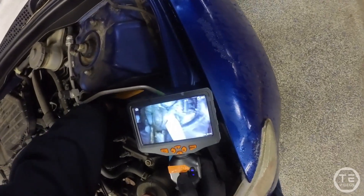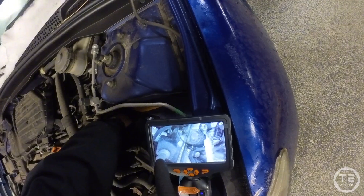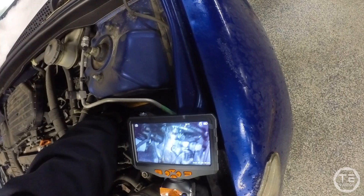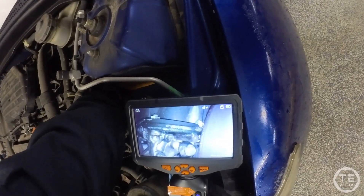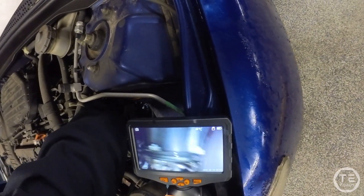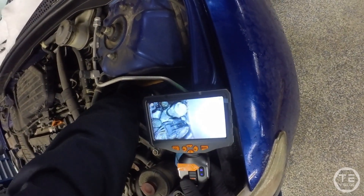Let's see if I can peek where this leak is coming from — angle the dangle. Got some coolant seepage right here. That's the air oil separator baffle. We have the oil pump right here, and you can see we are puking coolant right from the bottom of the timing cover. The only place that coolant can be over here is likely from the water pump.